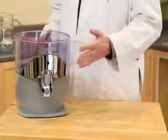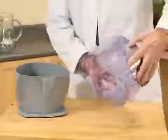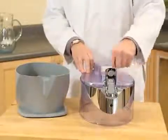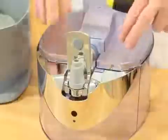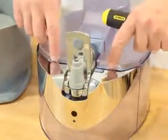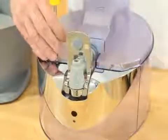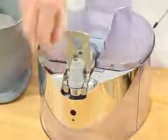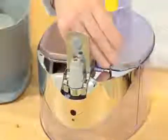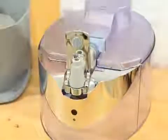To perform that, you lift up the supply tank, this bottom component, and turn it upside down. You'll see in the bottom here, which is now the top, there are 2 small Phillips screws. To remove this component so we can get to the battery connection, we just need to take those out. It's a pretty simple operation. If you can use a screwdriver, it's pretty quick. Just take out one screw, then the other screw, and now this piece will lift off.